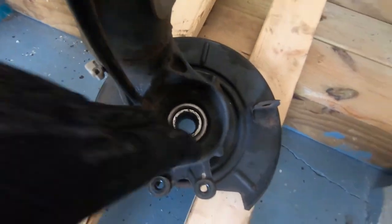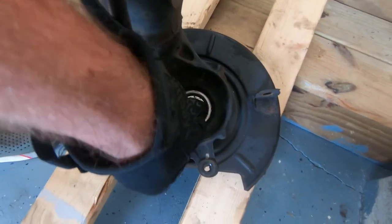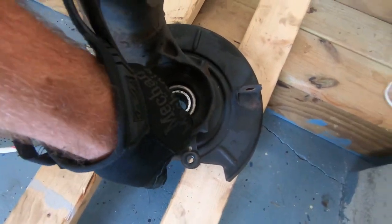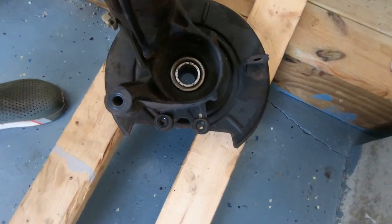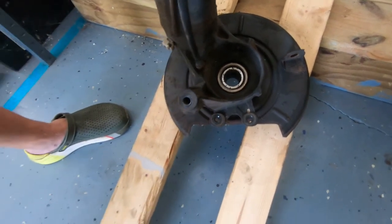All right, next we're pressing, or gonna hammer, the hub out of the center of the bearing. Just gonna use a socket that's about the size of the hub portion, so it'll slide through the bearing, and then it should just pop out the other side. It may take half the race with it, but if it does, we'll just pull it off with a bearing separator.